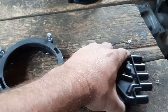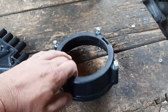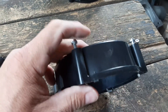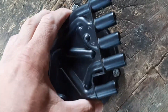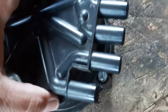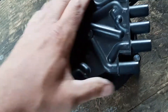After you do all that, you're going to be able to insert the upper part into the lower part — but you can't just put it in any old way. You have to make sure it's clocked right. All caps have a tooth so you can align and clock the distributor correctly. You want the rib to be in the right position relative to the top part. When inserting, you want this screw to sit dead center between the coil terminal and number six. Then push it in — you want it to be a snug fit.